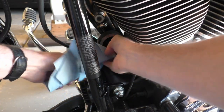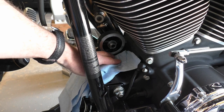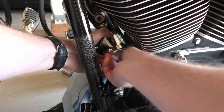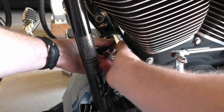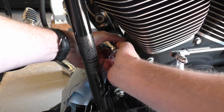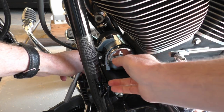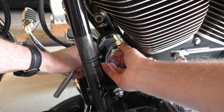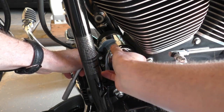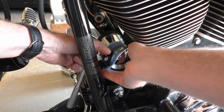I cleaned off my surfaces so they're good and clean after letting that drip a bit, and I put a rag down. Now I'm going to spin on the new filter as fast as I can — a little bit will leak out, but we'll get it on there quick. I do a little something that's not really recommended: they say you shouldn't tighten it with your wrench, but it's really hard to get a good grip because there's not much room. So I just give it a little snug, not too tight, so that I don't end up with an oil leak.